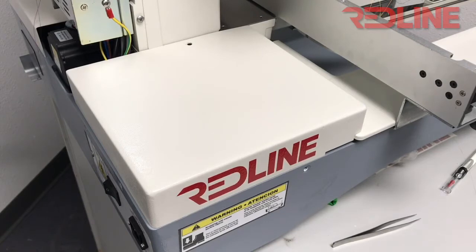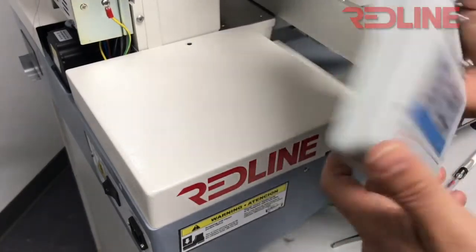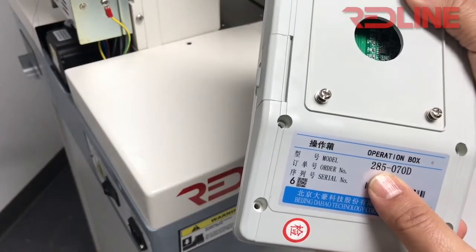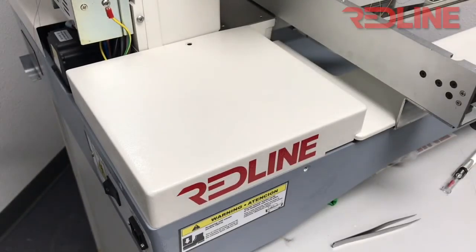In this video I'm going to show you how to replace the battery — it's a very easy procedure. The first thing you need to confirm is that you have the 285 model. How do you do that? On your screen, if you have the horizontal screen, or if you have the vertical screen, check the sticker on the back. You need to confirm you have the 285 model. The 285 model and up will be able to replace the battery, as those motherboards have a coin-style battery.